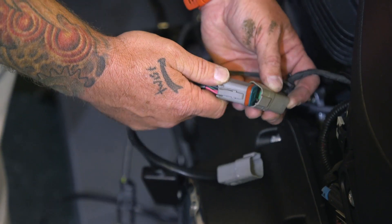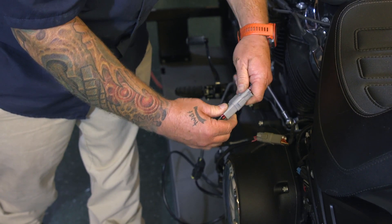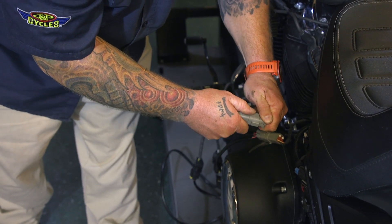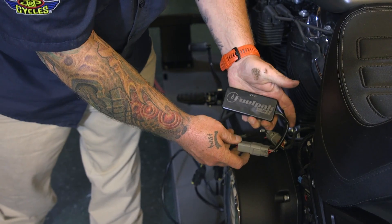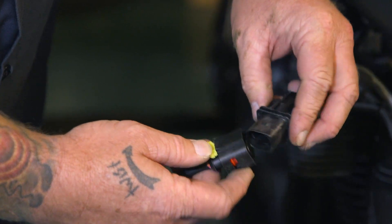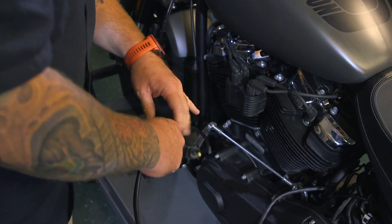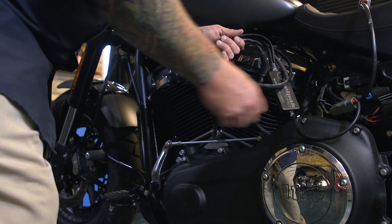The data port where you would normally plug in your FP3 is where the FuelPack Pro is going to get plugged into, and then the corresponding plug off of that will get you the plug where you put your actual FP3. There's a short wire coming off the FuelPack Pro that plugs into the rear O2 sensor you just installed. The long wire goes to the front O2 sensor — you probably can't mess that up because they won't reach, but just for reference: short one is rear, long one is front. Zip tie any slack to the frame.